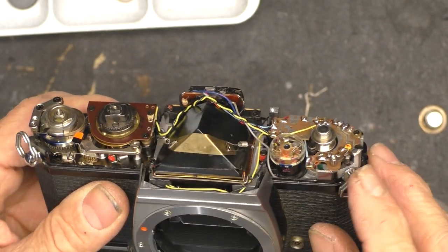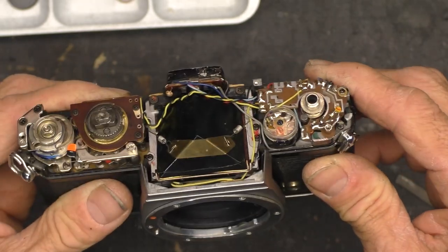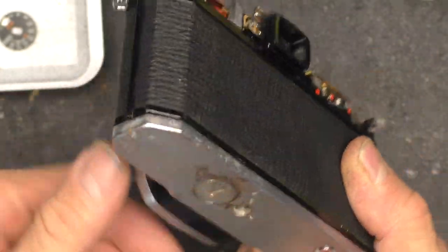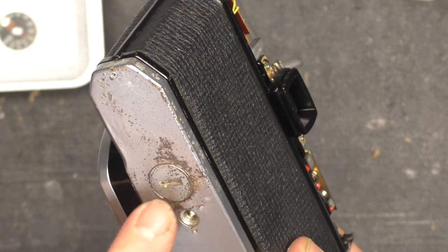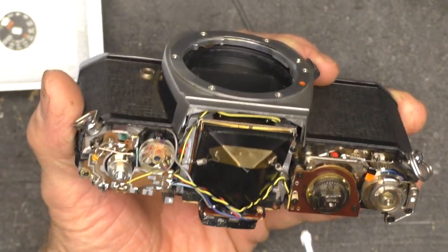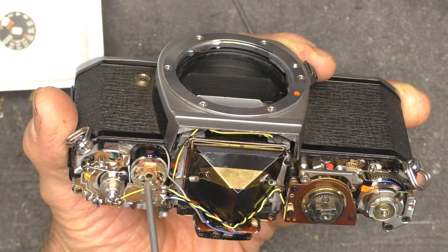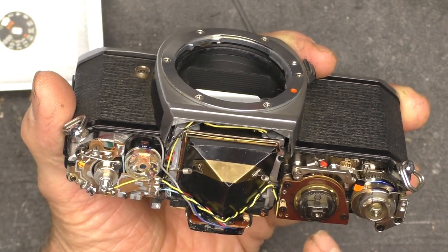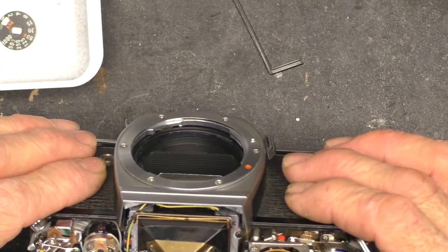The light meter is back in, and that was a struggle. I ended up having to take off the circuit board, get that out of my way, and go back in there very carefully — I did bend the needle a couple of times, but it's okay. I'm going to stick a battery back in and see if it works. It works again! I cleaned up the battery compartment — it had some funky connections and wasn't getting a good ground. In hindsight, it would have been a lot easier to just remove the four screws on the frame that holds the entire prism assembly in place, because it also carries the meter with it.